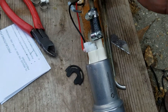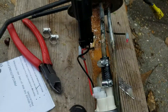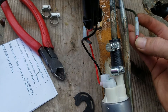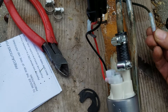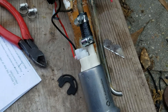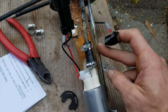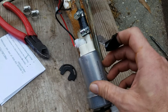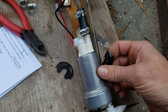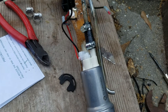This is the complete assembly. It came with a plug but I really don't think it's a good idea to put this plastic harness connector submerged in gasoline, although I can't imagine how a spark would occur if the plug stays tight. I'm a bigger fan of soldering the wires together, and at the very last resort maybe using crimp barrels — but I'll leave that up to everyone's opinion. Anyway, this was my fix for using the stock MK3 Supra pump hanger to put the 450 Walbro E85 pump on it.